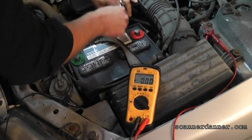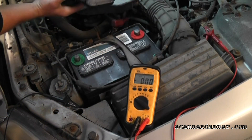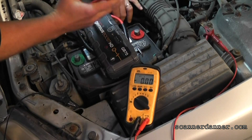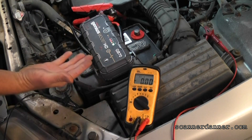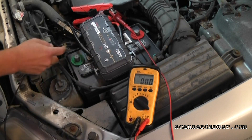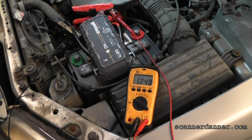Things that we run into in the field - I really think this tool is designed more for an emergency type situation than for the technician. Battery is disconnected. We'll go negative, then positive. Can I use this tool as the battery? The light is on. Of course no sensing of polarity - the circuit is dead. Hit my boost. Let's get a voltage reading here while we're doing this with no battery - there's 12 volts right there, no battery at all. Go ahead and start that. I think we'll leave it run for a second here too and see if this 15 volts does any damage to it.